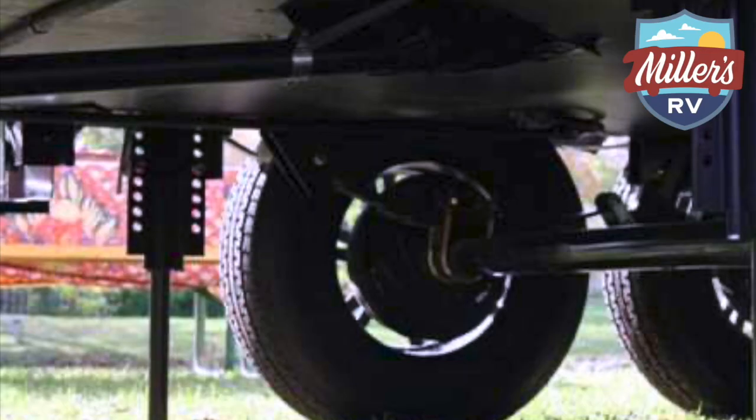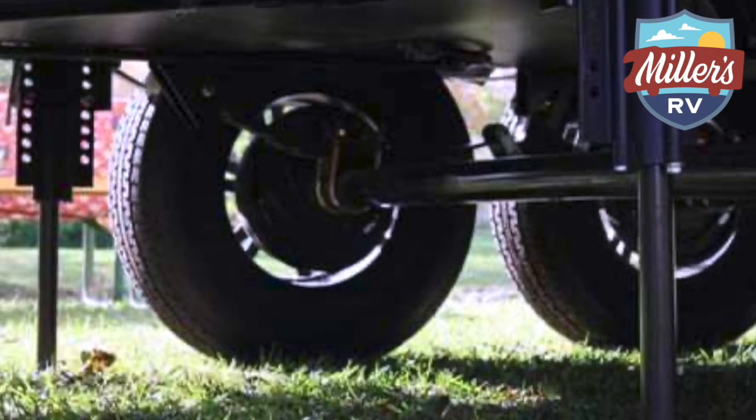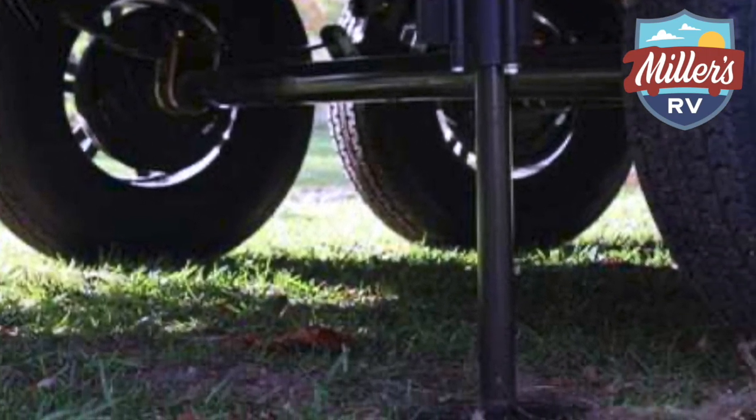If the engine's running, turn it off and try it. If it's off, turn it on and try it. There's one other thing — not very common anymore — but some motorhomes used to require the hydraulic or electric jacks to be down before you could put the slide out. So the most common things: park brake set is a must, and engine either on or off depending on the brand. Try it one way or the other, and lastly check that jacks are down, though that's not very common.